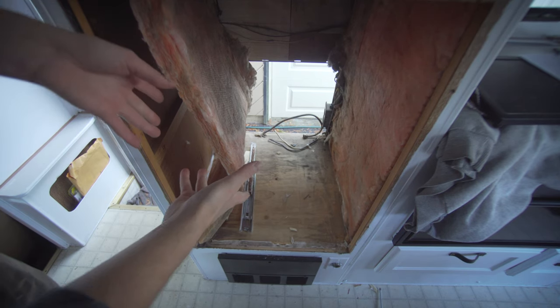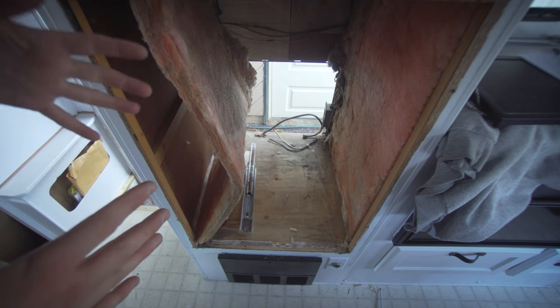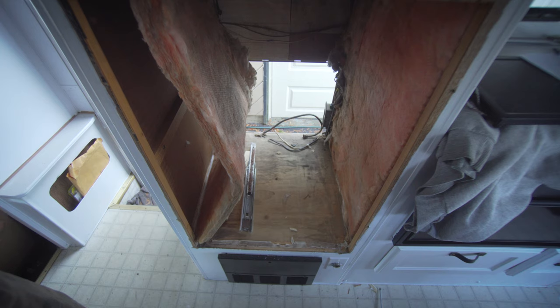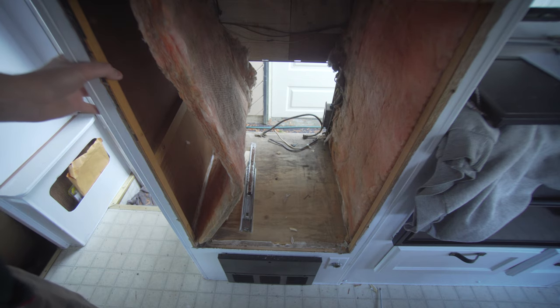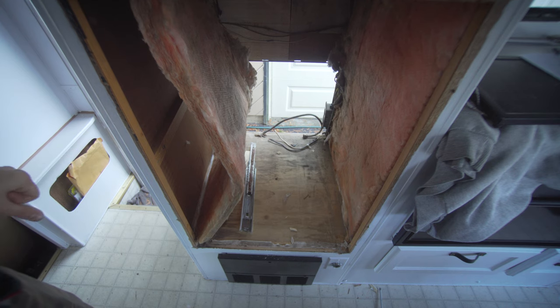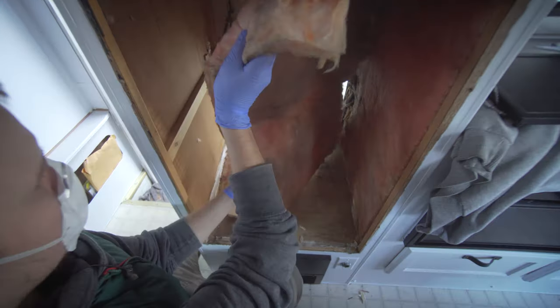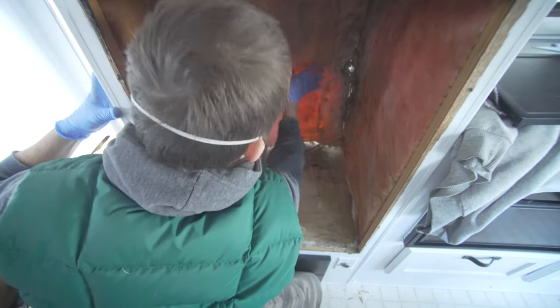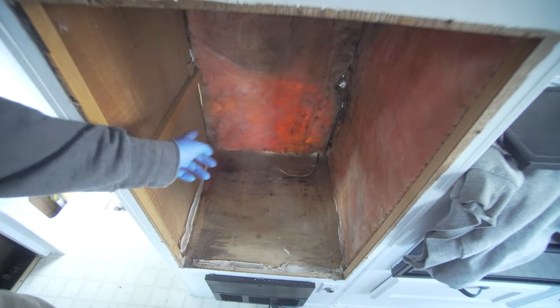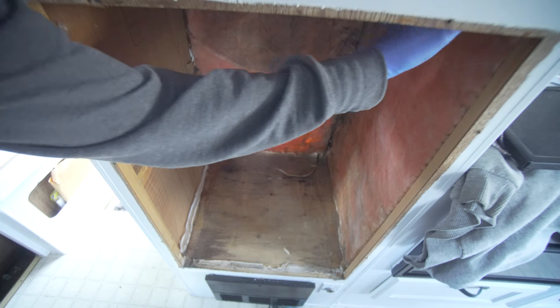There's insulation that's now visible, so I'm going to be covering that and making it look really good. What I've decided to do is remove this and then actually put it at the back to create insulation and still vent air, and then potentially cover it with plastic and seal it off with silicone. It doesn't actually need to be as insulated as the other one, though it's not a bad idea because it will keep your cooler running more efficiently to have it insulated from your warm van or trailer. I'm going to remove it for aesthetics and functionality so I don't have exposed fiberglass. For the panel next to the stove - whenever that gets hot it's going to radiate through - I'm still going to remove it, but definitely decide for yourself what you want to do.